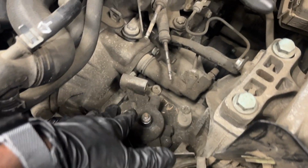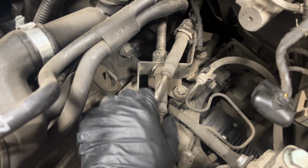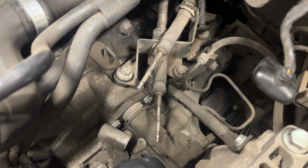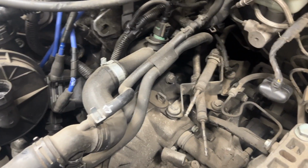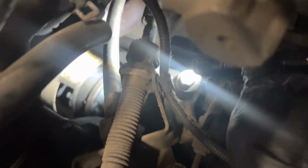Now that the shift lever, bracket, everything is off, the next step is to remove this 13mm, 1, 2, and 1 behind this, and this, the brake fluid line coming to the clutch slave cylinder. This one is the Torx, and disconnect the reverse light connector and the bell housing bolts. We are done. So this is a 13mm, 3 of them. That's the next step. This connector came from right there. If you can see, I'm shining the light on it, behind that bolt. It's actually here. Let's see.